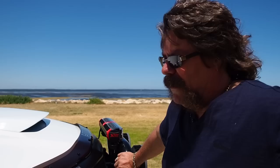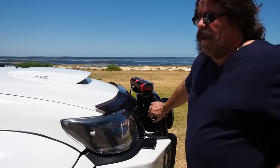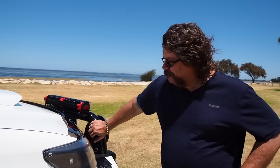The engine — I took it down to G-Turbo in Balcatta, Graham did his magic. Without these tyres it comes up at 340 horsepower at the rear wheels. Lost 60 horsepower to the rotational weight of the big tyres, but 340 at the fence — I'm really happy with it. It doesn't blow much smoke and will show a clean set of heels to a V8 Land Cruiser with the trailer on. The gearbox has been tricked up with a manual locking button for the converter — so in sand or on a hill descent I can lock the converter and just use engine torque without overheating any oil in the gearbox. Fantastic little weapon. The motor is very attractive — I can't say enough about it, it's reliable and awesome.